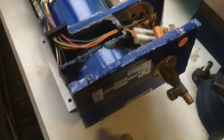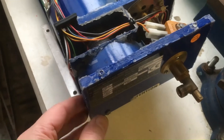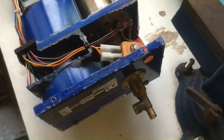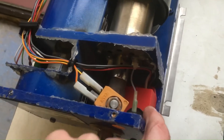You may have to undo the two screws on the bottom edge, and of course it's all siliconed together, so you'll have to carefully pull it apart, get a scalpel blade in there, and slice through the silicone to get it apart. Anyway, that's how I got the ignition module out.